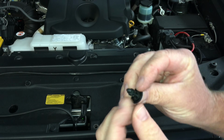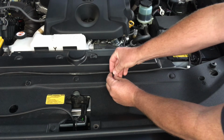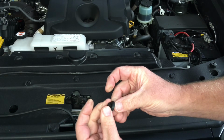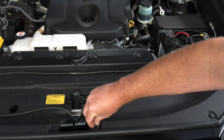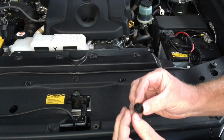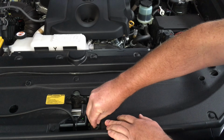Then you need to take it to a hard surface and press that back piece in the center there. We're just going to use, say, the radiator support panel here like that, and push it back out to reset it. Then as long as it sits up a little bit like that, it's not squeezing those center pieces out. Just gently place it back in there like that. Really gently. Don't force it, because you'll have one of these prongs bent back. They can be a little bit fiddly to get in position.